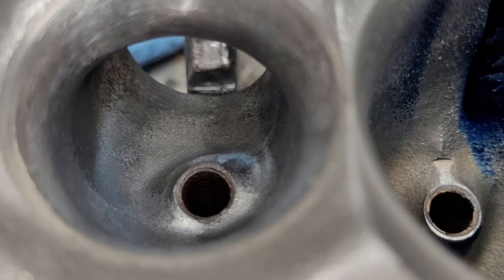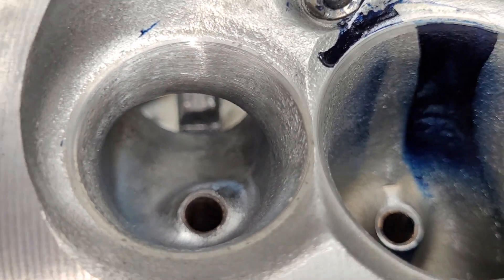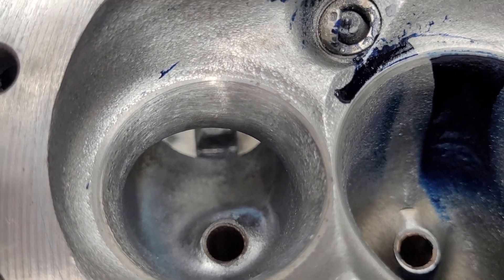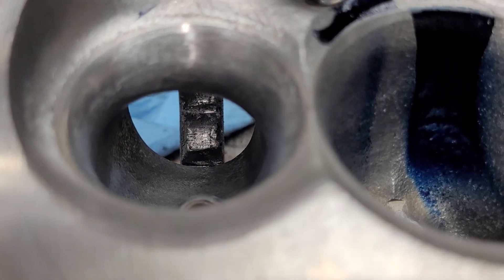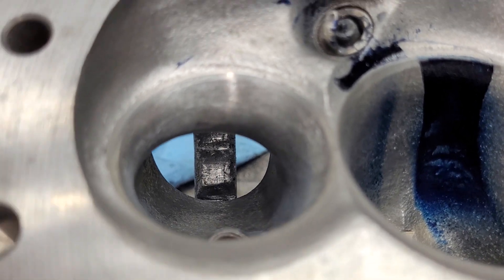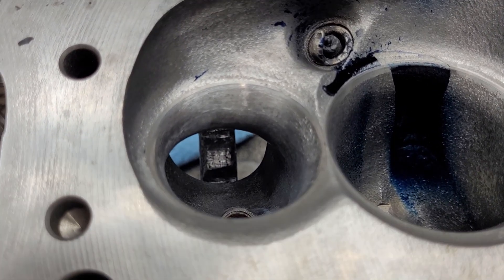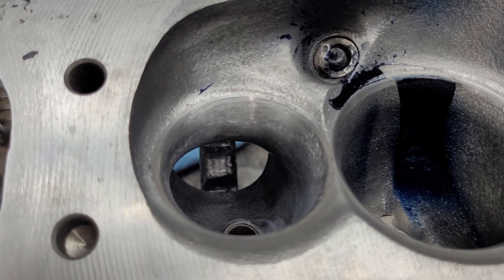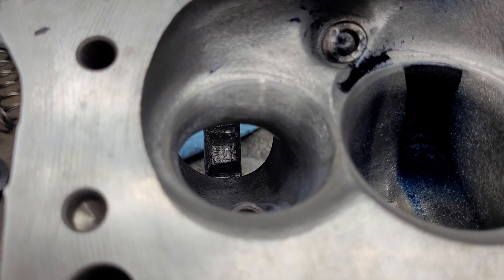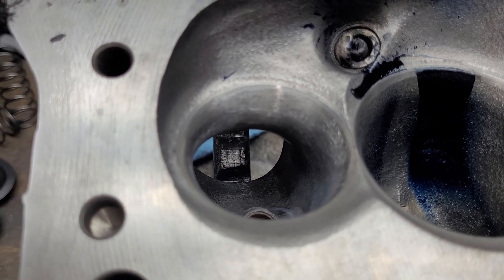I don't know if I showed you down the exhaust port - it really doesn't look any different, to be honest, because the amount I took out was so tiny. But that's the way I do it: if I'm going to change the throat ratio, since I kind of like tighter throat ratios, I'm going to do it in slow increments. Yes, it goes on and off the bench a lot - probably way more than most guys. Most guys just have a throat ratio they like and cut it to it and send it. I'm a little more ADHD than that.